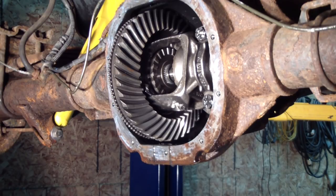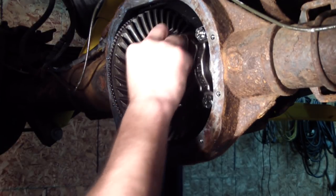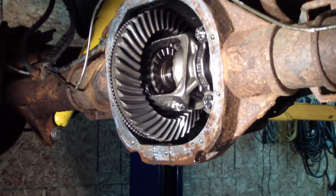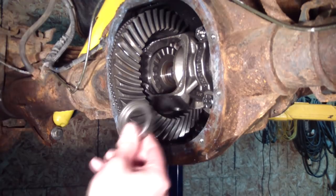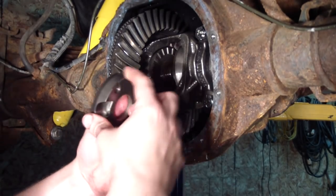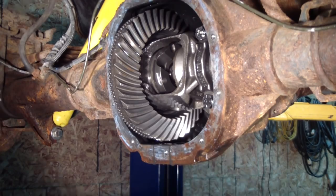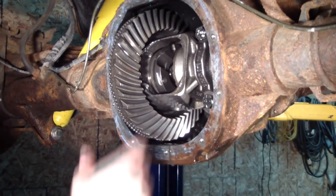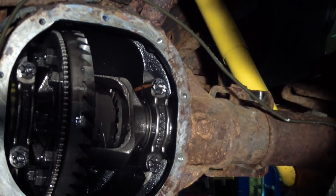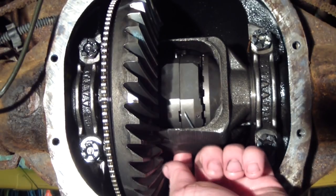The instructions didn't mention much about the c-clip, but it looks like it goes in right now. I've got my side drive gear in, the axle pushed all the way in, c-clip goes in, axle gets pulled out. There's nothing locking the c-clip at this point — the spacer is going to lock that c-clip in place with this groove. This driver has flat spots so it can only go into the carrier one way. When that lock pin goes in, it'll keep those spacers from walking outward. I'm doing the passenger side now with the groove facing outward to get the c-clip in.